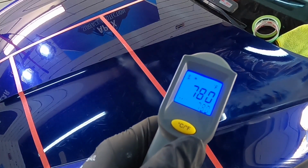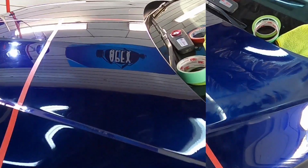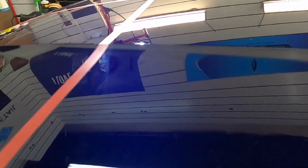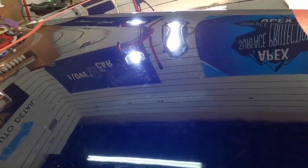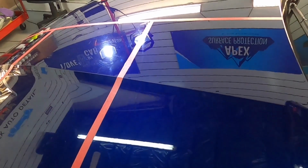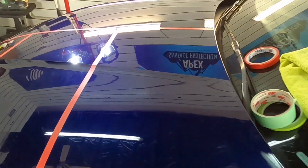When I talk about temperature spiking, I always have those chime in, hey, my car sits outside where it reaches 150, 160 degrees, and it doesn't fail. Yeah, but the whole vehicle, the whole panel is heated up and expanding in one uniform motion, whereas if you're just working a small area on a panel, just that area will spike and the rest of the panel is room temperature, and that causes the stress. Remember, primer, base coat, and clear coat are three different materials and will expand in different ways when heated.